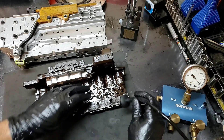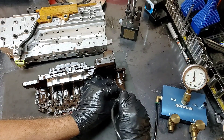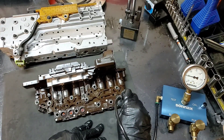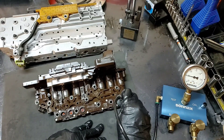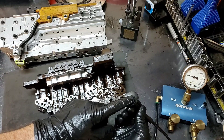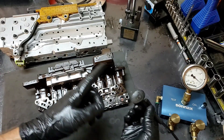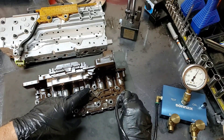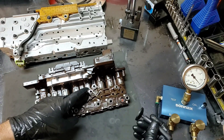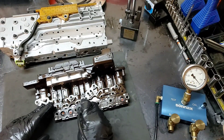This one right here gives us a good vacuum. If I just put my finger in here I get 25 inches of mercury, and if I test this membrane or this pressure switch it gives me a perfect vacuum. Let's move on to this one.